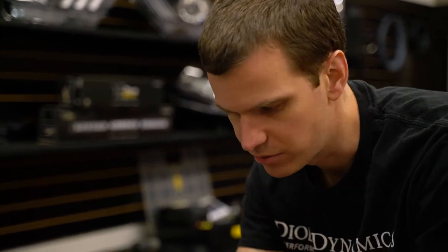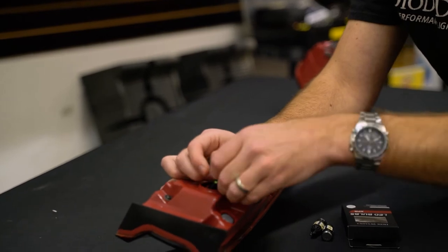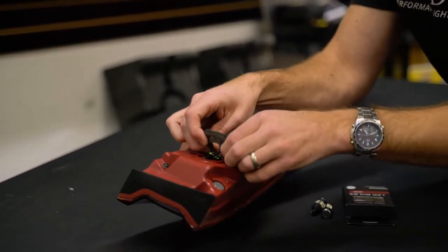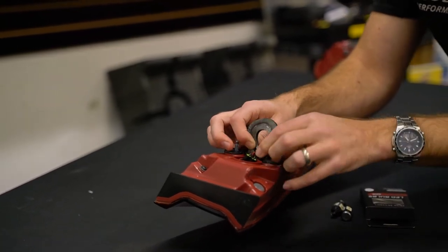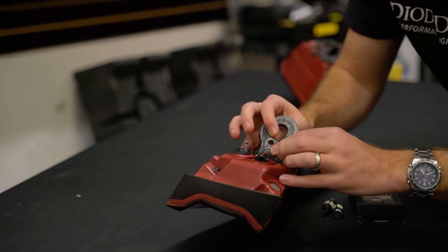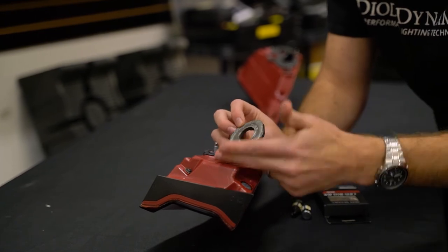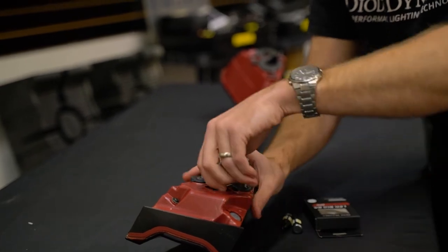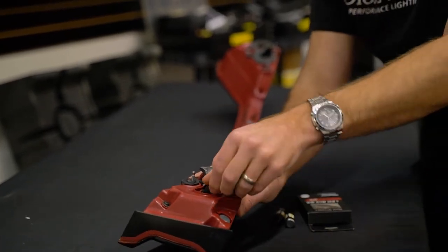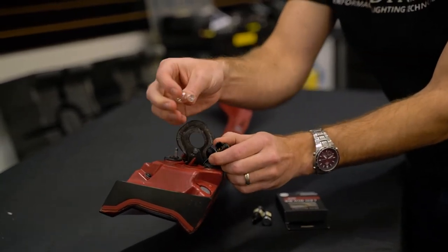What I'm gonna do — my car is still pretty new — so I'm just gonna pull up on this foam itself carefully. It's just held on with adhesive, which you could replace if you need to, but it's still pretty sticky, so I'm gonna pull it up and then just put it back in place when I'm done. If your car is a little older, you might want to make that slit because this foam will probably wear out along with the adhesive. Now I've got plenty of slack here, so I'm gonna grab hold of this socket, turn it counterclockwise, and lift it straight out. From there, I can just pull straight out on the bulb itself.